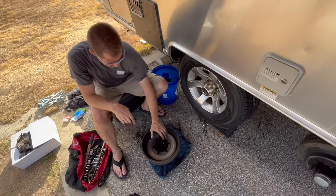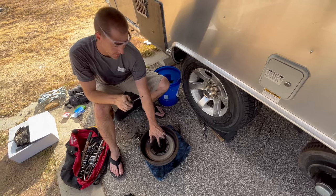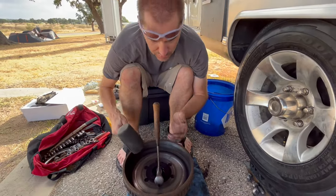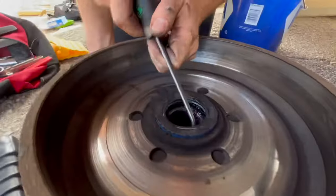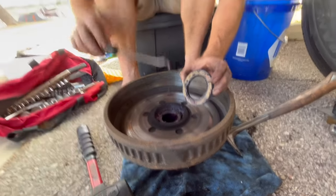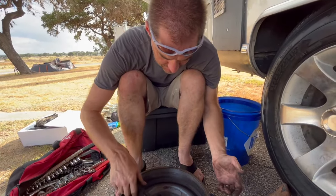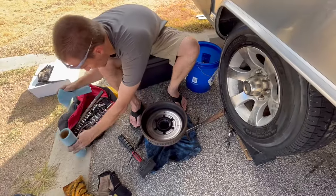The next step is to remove the inner axle seal and the bearing below it. I'm going to start with a hook tool. There's room for this seal to drop down a little — I'm really trying to get it up. Once it starts to break loose, we'll start it moving and then I should be able to lift it. Would you say the most frustrating part of this job is putting in the new seal? Taking this out, fearing any damage, and then putting in the new one and getting it to slide down straight — probably the most time-consuming part. The old one goes in the bucket.